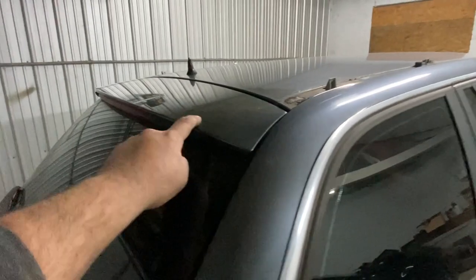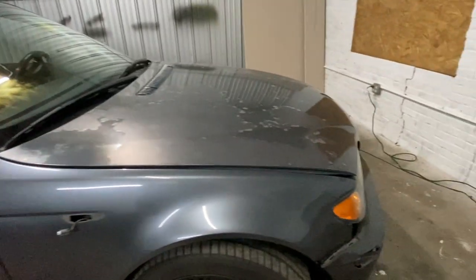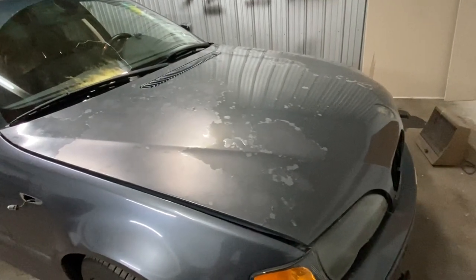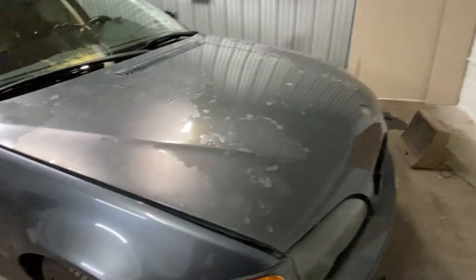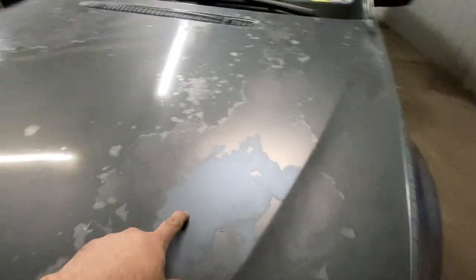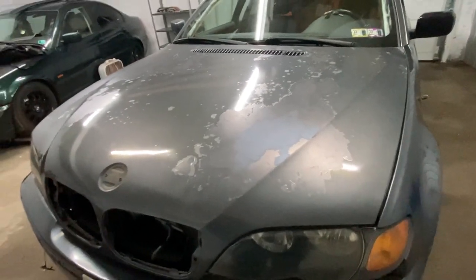The underside of this car when I got it was completely rotted, so I needed a whole new rear hatch. The hood is the only one that has failed — the clear coat is peeling off everywhere. It wasn't like this when I got it; I put this on like a year and a half ago, and it has now lost all of its clear coat. In some areas we're down to the base color coat, and in others we're down to the previous base color coat underneath. I need to sand this really well so I don't paint over already bad work, because then it'll just flake from the bottom and ruin what I spent time on. That's going to take the most time to get sanded and prepped.